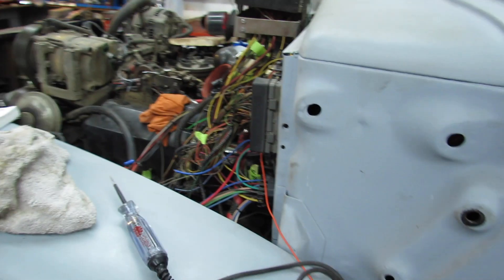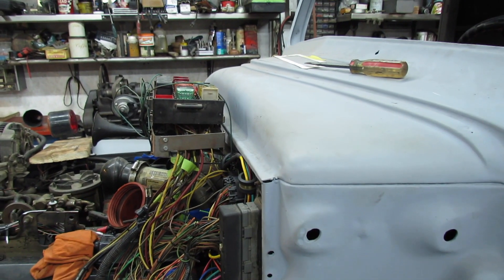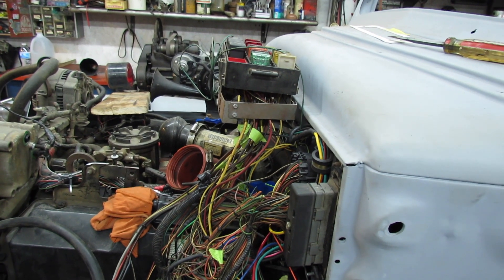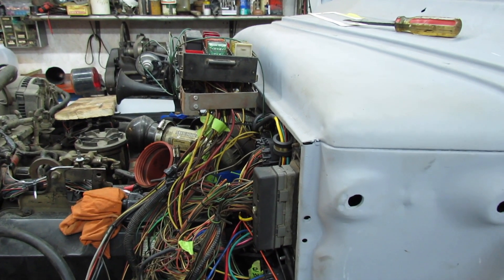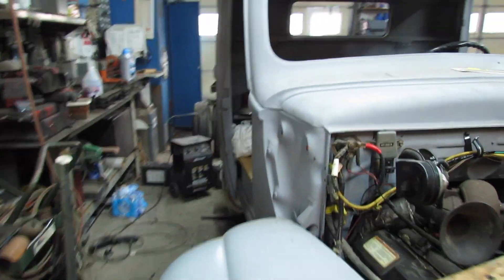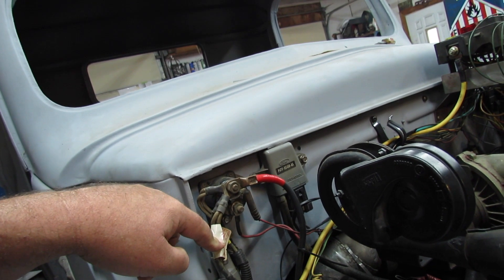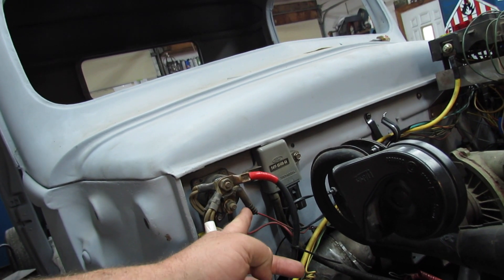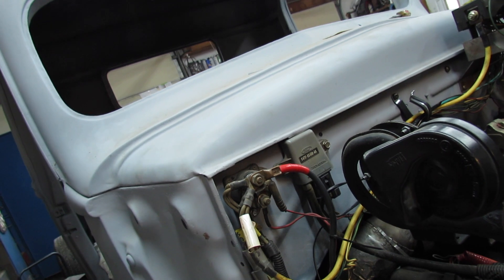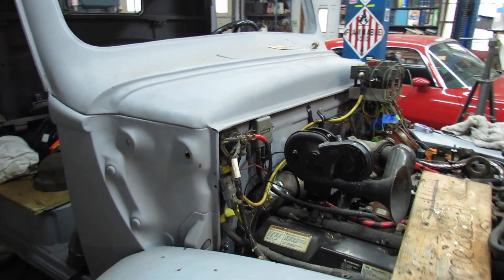Well, I couldn't really stand it, so I came back out here and did some more studying. Best I can tell, I don't need that fuse 10 for anything. It says it's for starter relay, but it does not seem to affect that any. And obviously, the only thing that starter relay needs is big power in, which is all here, and something to tell it to start. And then that wire goes to the starter, which has another solenoid apparently on the starter — which is kind of redundant, but that's alright. Redundancy is okay.